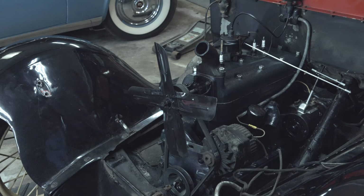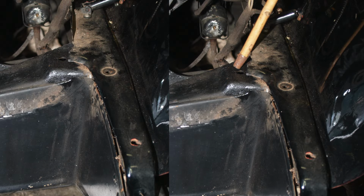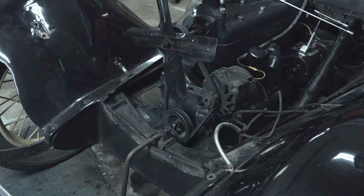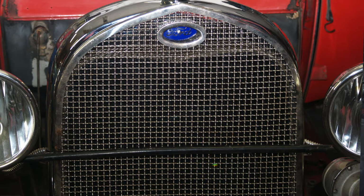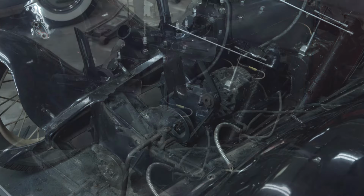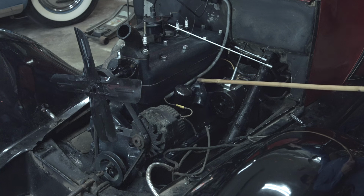It has little springs on the nuts and bolts that you put on there, so it can move a little bit, so it won't be rigid for the car moving down the road and all. It's important that the radiator is able to move somewhat. But it'll go right on front, then the radiator shell will go on it, and then we'll be ready to take a ride.